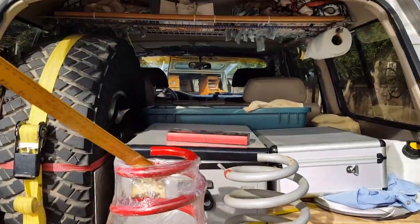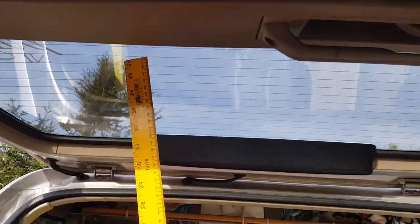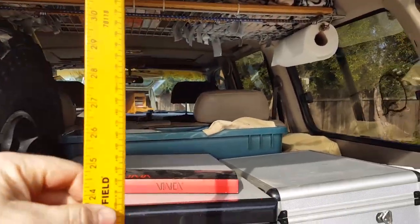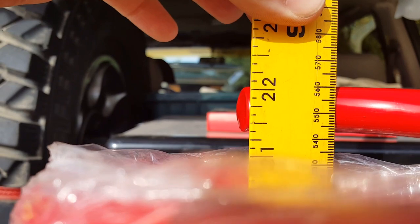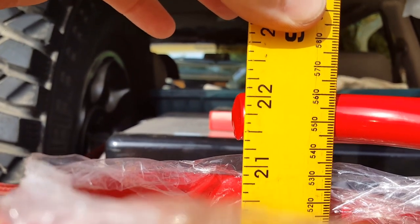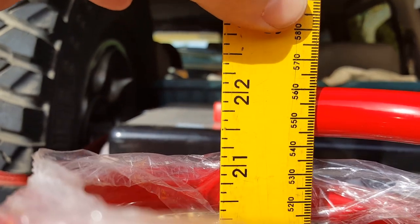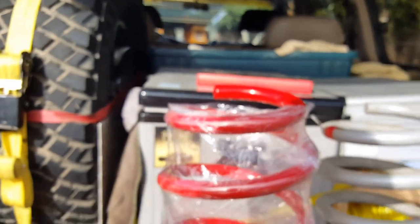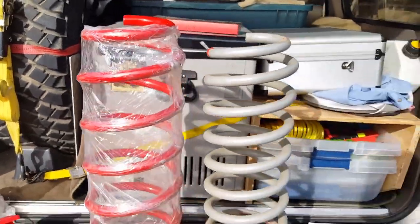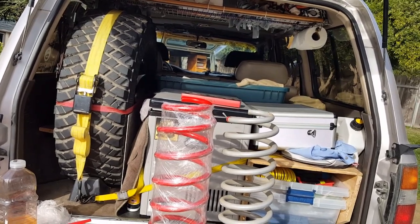All right, let's get the free height on the driver left hand side. I'm hitting up here. Okay, quick and dirty specs is, you know, pretty much 22. 22 and some change, but nothing to report back. We'll see how those are compared to the spec. The spec number, and I'll report back on that to you also.